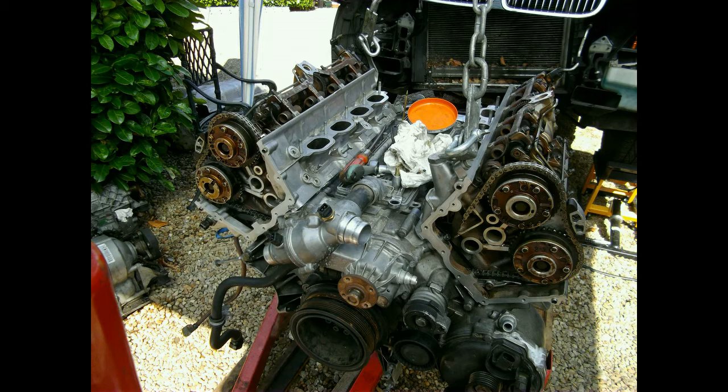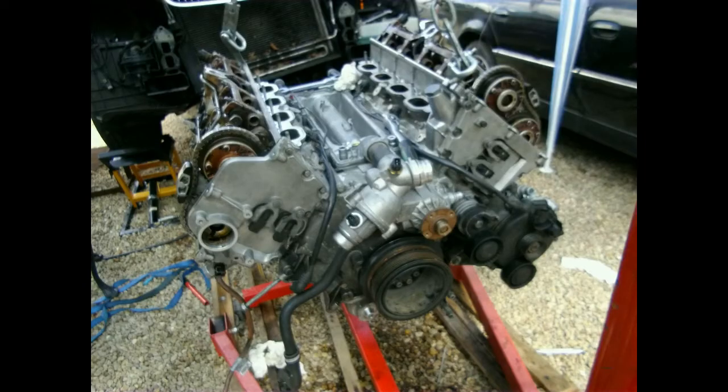When you have to install cylinder heads on any V8 engine, first put it on TDC and then retard it 45 degrees. This way none of the pistons are at the top. BMW even has a mark on the front cover of the engine as being the safe point. Went on and installed the upper timing covers with new gaskets, then the solenoids for the vanos system — two on each side, there are intake and exhaust vanos on this engine. Note the valve covers have a different shape from one side to the other.